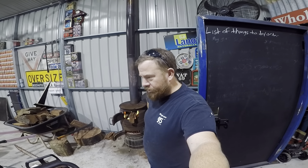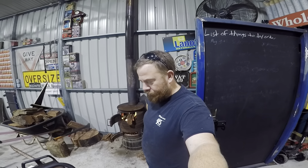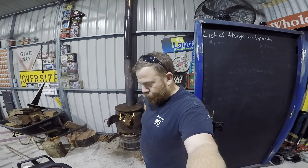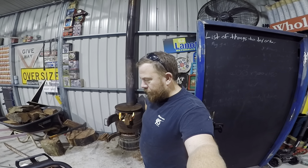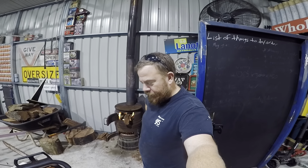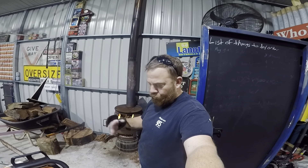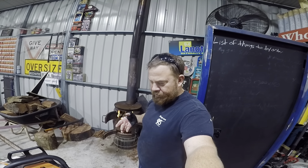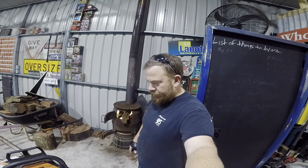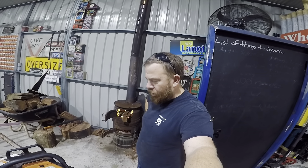You can normally do a 6x4 ute load in one tank of fuel, and that's good going. I reckon it's all about getting it in and getting it done quick. Maintenance: do the air cleaner every time, fresh fuel, all that kind of stuff. Get the spark plug once a year, once a season, if there's anything wrong with it - which there never really is. I've only had it for a year and the only thing I had to do was the clutch springs.